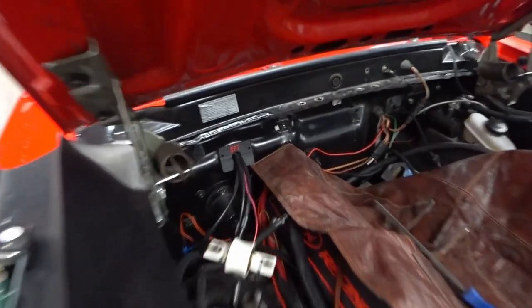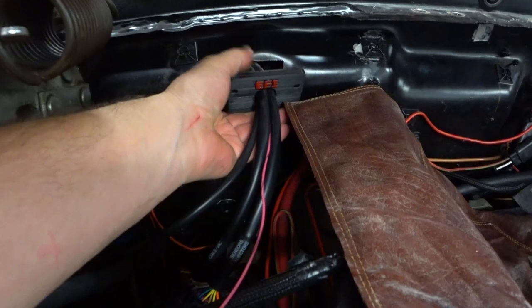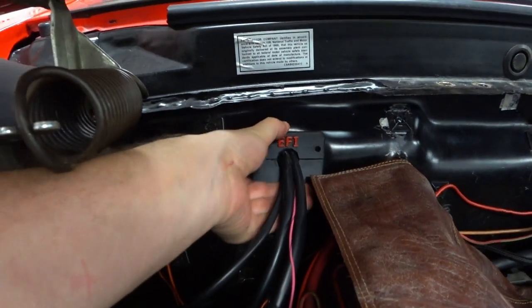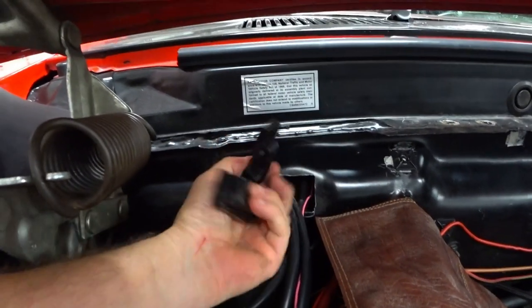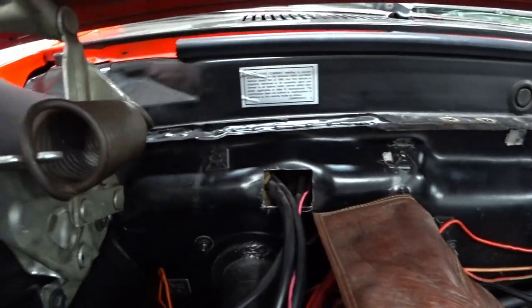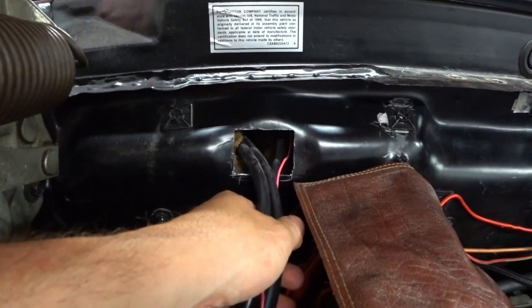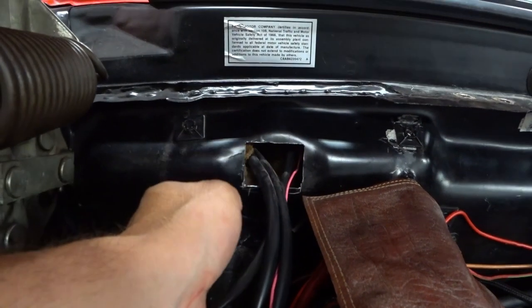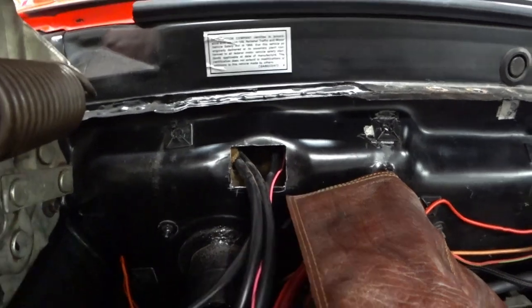So I just inserted my homemade firewall plug here. It worked perfectly. I have not attached it yet, but this is the principle. So I'm satisfied with that. This is the dimension of the hole. It must be 40 millimeters high and 50 millimeters wide. Otherwise you can't insert the contacts. We can go inside and look at how it looks.